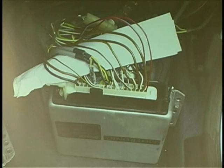I'm not going to get too anal and start checking the crank and cam sensor. For what? It's a no start condition, no spark. Isn't it easier to take a test light, and you better know where you're putting this thing? Because if you're checking powers and grounds, you're okay. You take a test light from the positive side of the battery and you go like this. Is that a reference voltage or is that a ground? Big pop, it's done. Reference voltage, reference power will not tolerate high current.